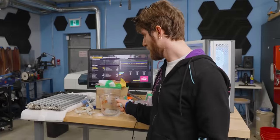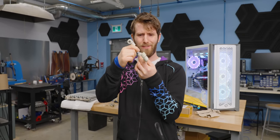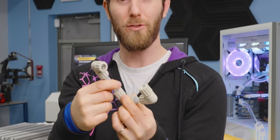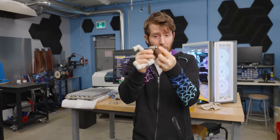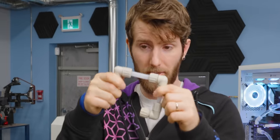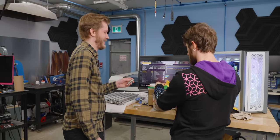The plastic fittings I'm hoping we can use because if we're going to do hard line with this tubing, our only chance of bending it is going to be to use right angle fittings, not to bend the tubing itself. These metal ones, while they are right angle, are threaded on one side, so they're not going to help us mid-run. We have only eight fittings total. We need these for that. I think we got scammed pretty hard.